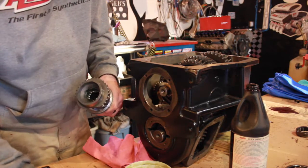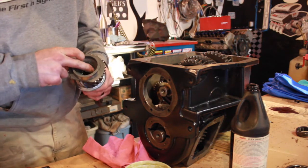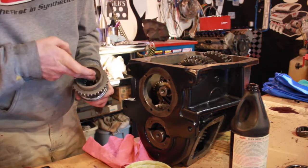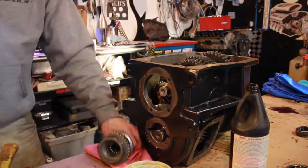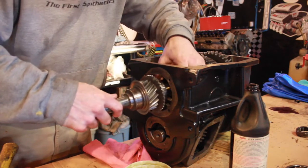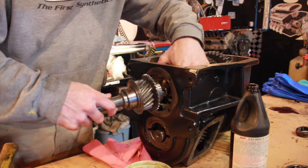Just packing them in to the bottom snap ring, all up against it. That grease should be nice and heavy to hold those for us while we're messing with it. Flat spot on the bottom. You have to kind of hold the brass synchronizer piece up a little bit while you do this, just to keep it out of your way.